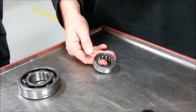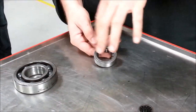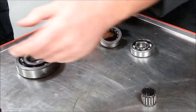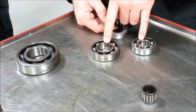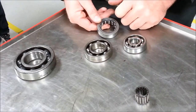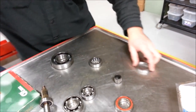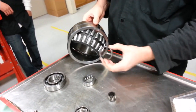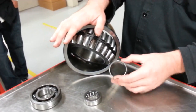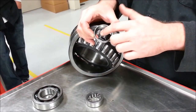In my 20 years as a mechanic, I've only seen one opportunity to change a bearing to a different type — on Harley Davidson Twin Cams, where companies were switching those two camshafts from one bearing style to a pair of the other. One bearing I'm missing to demonstrate is called a Timken bearing — basically one half of a roller bearing that sets in a race. These are commonly found on the steering stem where the handlebars attach on modern motorcycles.